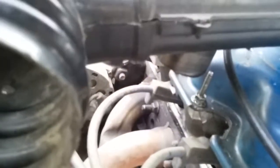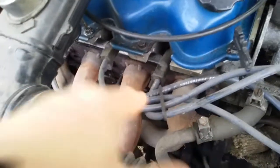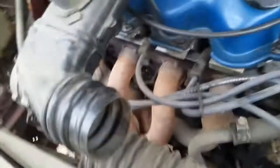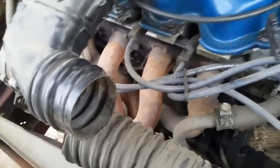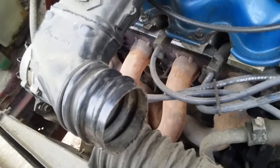There should be a chrome foil on most of them that connects the exhaust manifold up to the temperature valve on the main intake tube. But this one being a high output version does not have that. If you have the normal one, the whole exhaust manifold is just cast iron, and it will have that aluminum foil-like pipe that runs up to the bottom of this here.